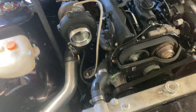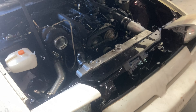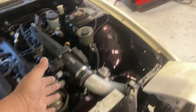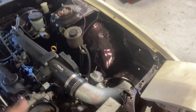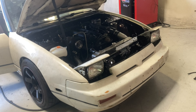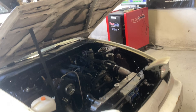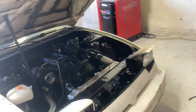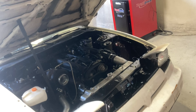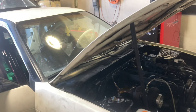On all the new piping we've done, we've already ran updated fittings. My opinion — I don't really like how this side is set up, I would have changed it to a new piping setup, but we're trying to save the customer some money. Maybe we can change some of that stuff later. For now, let's just see how it holds up. We're at 12 psi right now and I don't see those hose clamps holding much more. We'll put it on the E85 pretty soon — probably do one more pull on the 91, fix the coil pack and boost leak issues, and then let's get it.